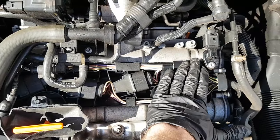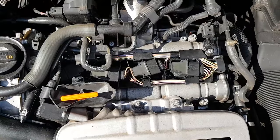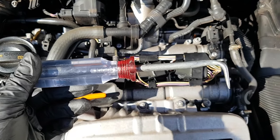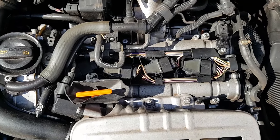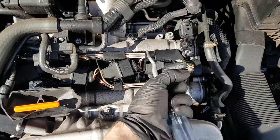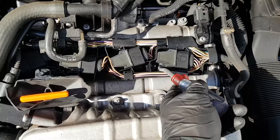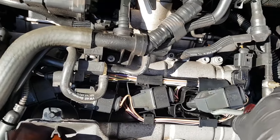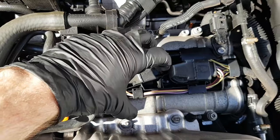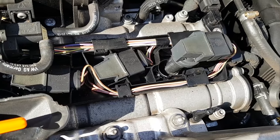As you can see, they're quite flush with the wiring loom and you can't really get in there to get them out. There are a couple of techniques for getting these coil packs out. There's one where I use a hook tool like this, which works quite well. For the DIY enthusiast there's always the cable tie option, which seems quite popular — slipping a cable tie underneath and around the coil and using it to pull the coils out. I just put the hook in and pop the coils out. It can sometimes help if you can twist or rotate the coil, because these coil packs have rubber grommets mounted in them, as we'll show in a sec.